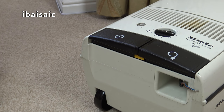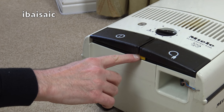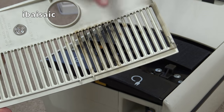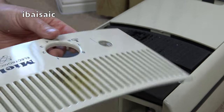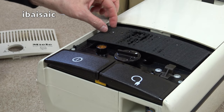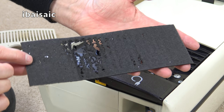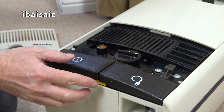I just discovered something by accident - there is an exhaust filter. When you press that, you can see that the grill lifts up. And again, we can see evidence of the burning. I can see more evidence on the exhaust filter. I might be able to get that burning off. It's unlikely I'll be able to buy that part nowadays, but I'll be able to cut something to fit. You can see it's had a bit of a catastrophic event - possibly flames have actually come up through the grill.